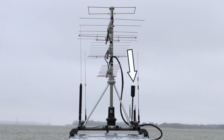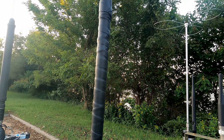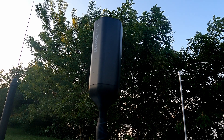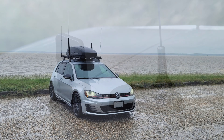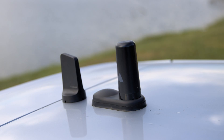This funky-looking antenna in the back is a WeBoost cellular signal booster. These are very common on field work trucks — I saw them everywhere in New Mexico oil fields — and I must have been the only passenger car that had one. RVs and overlanders use them too; they're great when you have a weak cellular signal and need to pull it in. At the back of the roof is what used to be my primary NMO port for my dual-bander, but since I frequently put a cargo box on the car I needed something stubby that would fit underneath. I've chosen this location for my GMRS antenna. I use GMRS for very close-in communications when traveling with family or in a group, so I don't need a high-performance antenna here.